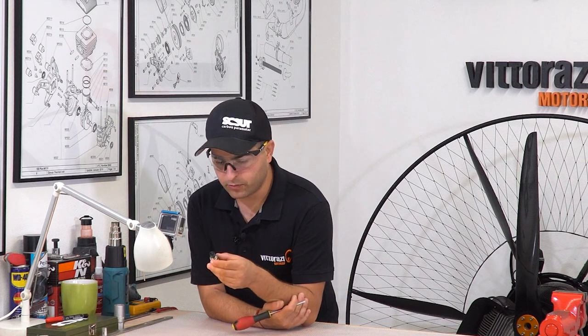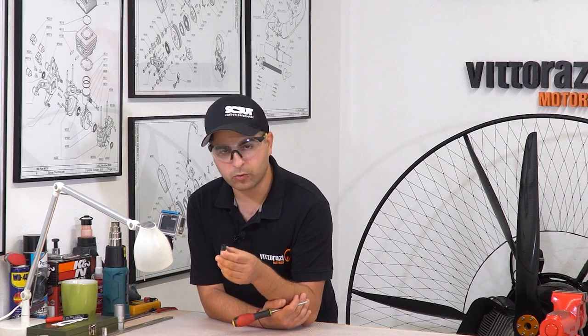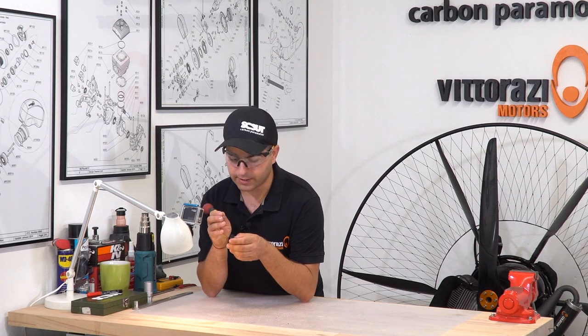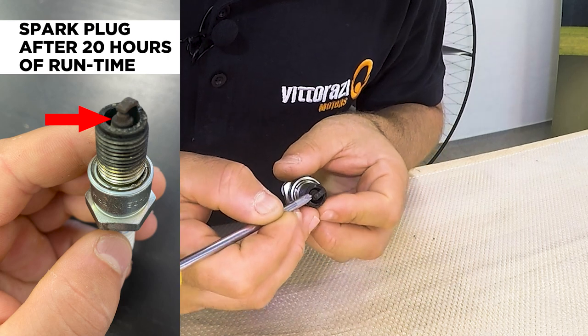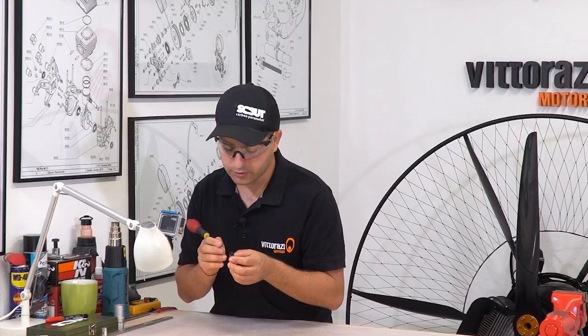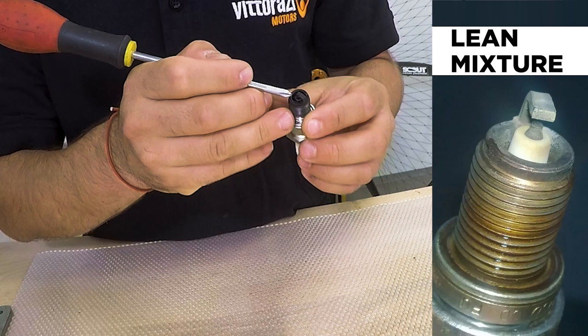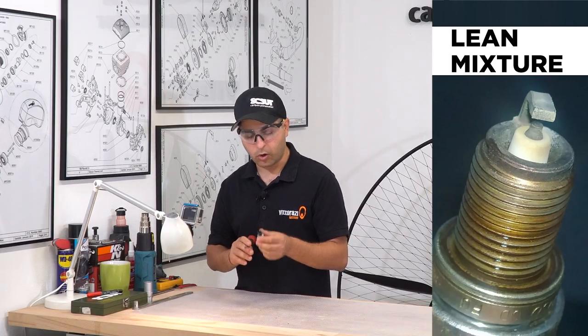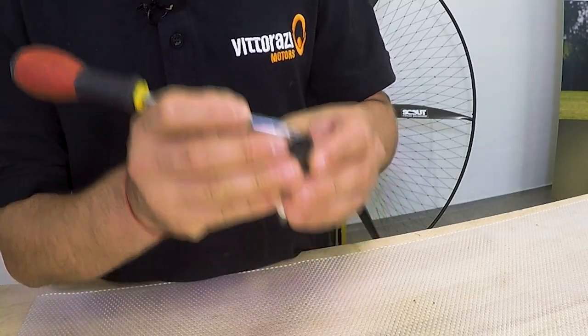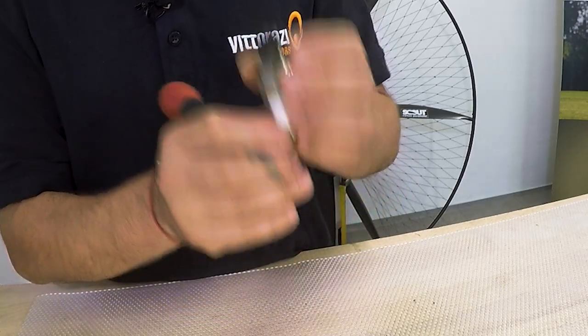I'll keep it simple and give you a small guide of how to read your spark plug and when to be concerned about your engine. The element that tells us how the engine is running is the central electrode and the ceramic that surrounds it — that's the part we want to read the color on. If you find the spark plug is kind of whitish, that means you are really running on the hot side. If your spark plug is way darker and has way more deposits, that means your engine runs on the rich side.